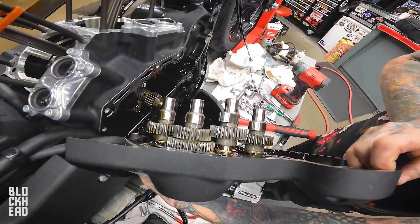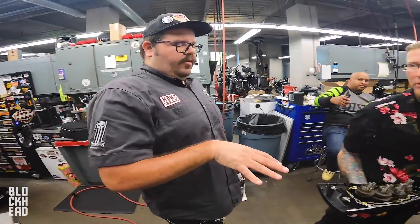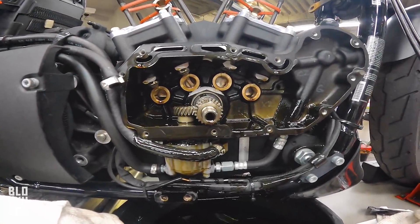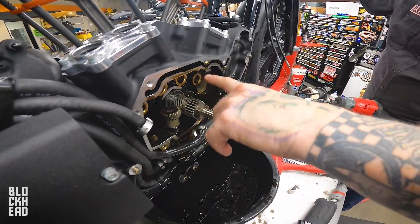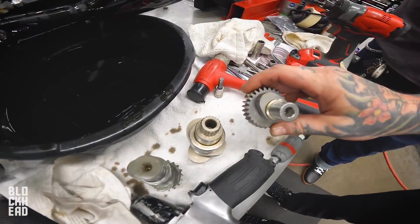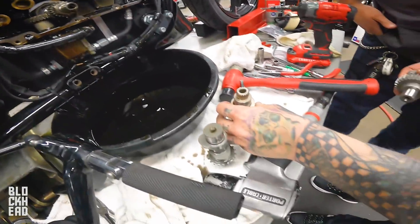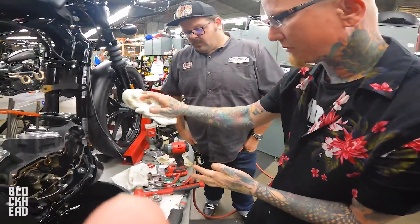There's your cams. You're going to pull them out, tie in the new ones, and put it back together. That's a 590 cam. The Sportster lobe — look at the size difference. It's almost like it's a smaller engine. One individual lobe per cam. For those of you that don't know, the Sportster is derived of four individual cams — one cam per pushrod basically, much like the original Harley-Davidson motor quad cam lower end.